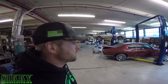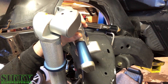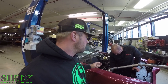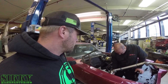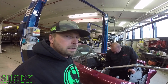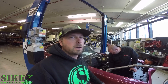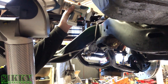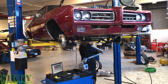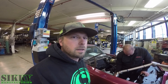Awesome stuff is happening on the GTO today — we're getting all the scans done. This will give us a 3D image of the engine compartment and all the key locations for the motor mount holes in the subframe and the front subframe, as well as the holes along the frame rails on the backside, so we can get this transmission cross member designed and all bolted up. Once we get all this stuff scanned in, we'll move to the computer and start doing the design work, tackling some of the challenges as far as clearance issues and getting this motor in the absolute perfect location and perfectly aligned.